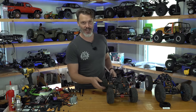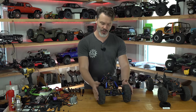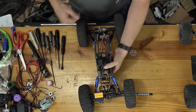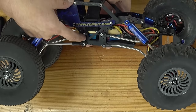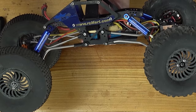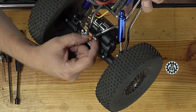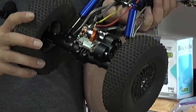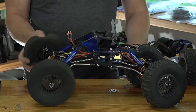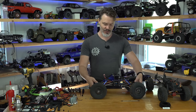This is a 2.2 MOA comp rig — a chassis somebody cut in their basement out of acetal plastic. On the sides there are a ton of link mount positions. There's only one position for the lower link, but on the upper link you have all of these choices. On the rear you can see a link riser attached — normally the links would be mounted much lower, and this riser has a few positions you can choose. This is how you tune your anti-squat. This is an MOA, so front and rear are independently controlled, and the anti-squat characteristics play a big role even when the axles are decoupled from each other.